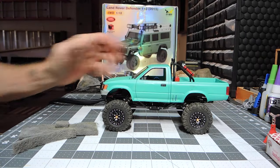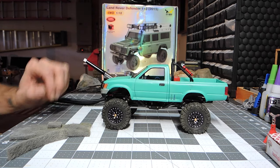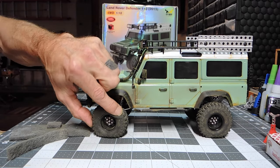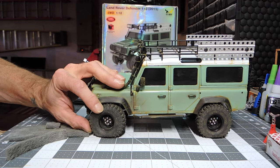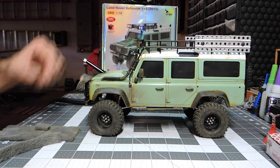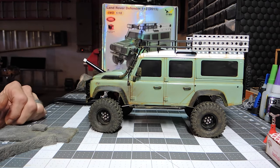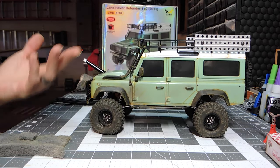Way back when I had the current tires on this thing, I had them set up pretty much in full droop. I kind of like to be running anywhere from eight to ten pounds of pressure, and I still have just one still set up like that on the left front. As you can see when that tire begins to compress, it lets go of quite a bit of sidewall and the rim starts to sit considerably lower to the ground. For a smaller lighter truck such as this, that worked extremely well — it crawled like a champ, even side-hilled and did gap stuff really well. Love these tires too — great one-inch stack, really perfect for this.